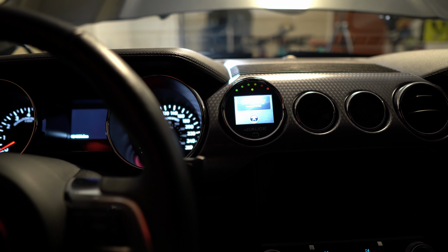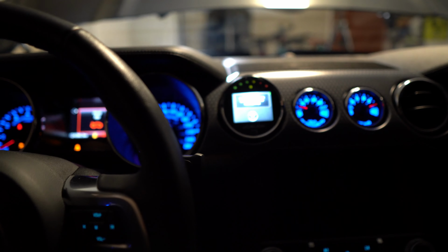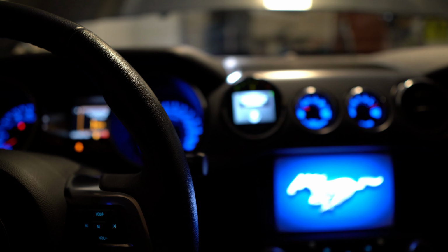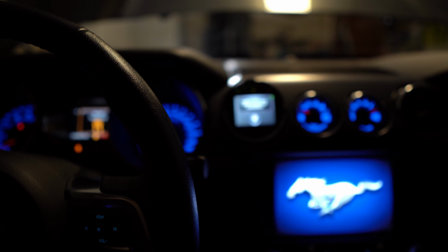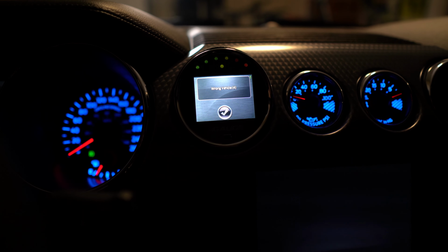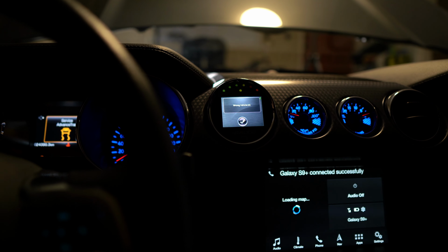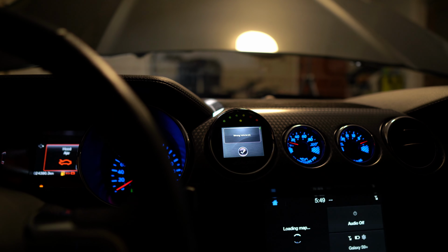See, it says initializing communications, do not turn off, resetting ECM. Well, that's not a good sign. It says wrong vehicle 4. Okay, well, let me check into that and see what's going on. Well, that pretty much settles that for the most part. When I was going through the N gauge, right when I was trying to load the tune, it comes up at the end and says wrong vehicle. So beats me. I'm sure somebody out there knows.